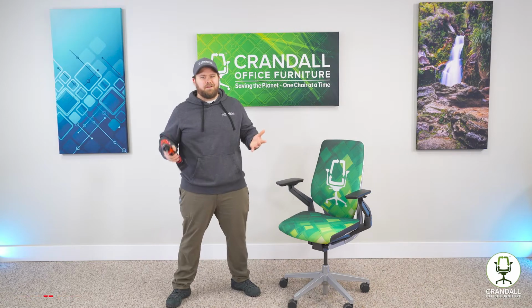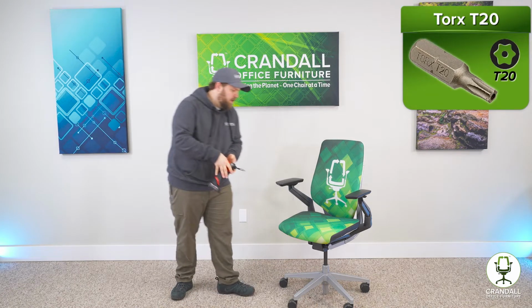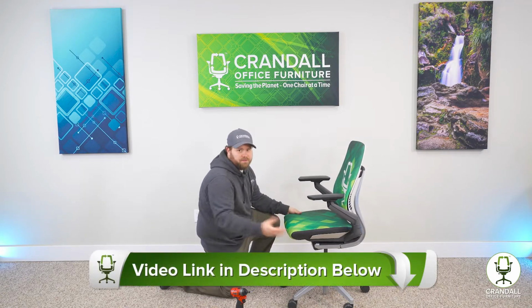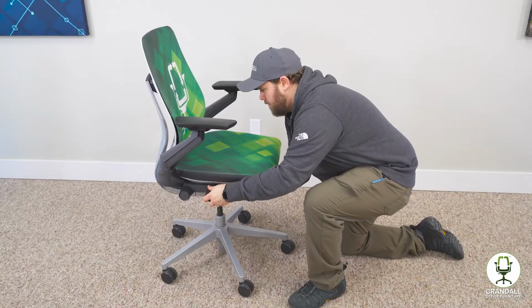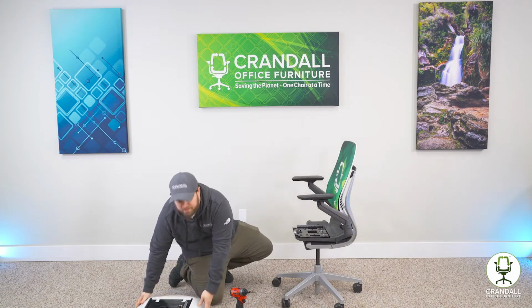All right, so to get started, this is going to be a quick and easy one. The only tool you're actually going to need is either a screwdriver or a drill with a T20 Torx bit. The first thing we're going to do though is remove the seat on the Gesture. To do that, we do have another video that's going to show this a little bit more in depth. We'll have a link in the description below. We're just going to roll the seat forward, depress that button, and then get that seat to come right off. So quick and easy to remove that seat. We're going to set that aside.